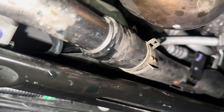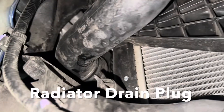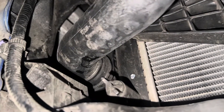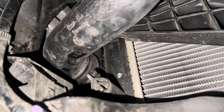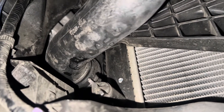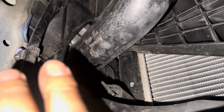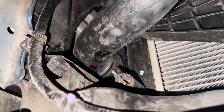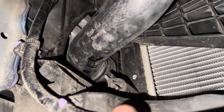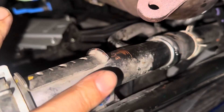We just finished draining from this hose. I wanted to show you — you can also drain from the radiator petcock right here. That's where you turn it and drain the coolant from the radiator itself. I just found it now; I forgot I had removed my intake resonator a long time ago. The intake resonator just quiets down your intake — I removed it because I wanted a little more intake noise. Now there's access to that drain on the radiator, which is very convenient. Next time I'll drain from there, though I think draining from the lower hose is better since it's the lowest point of the coolant system, so you get more out.